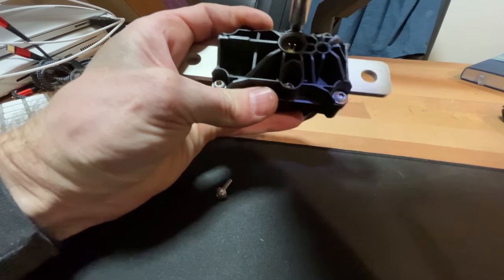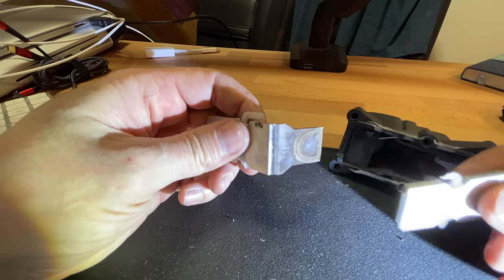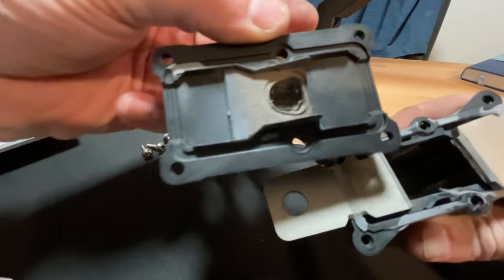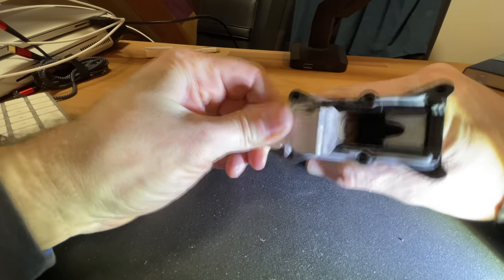After I took out the blown fuse, I had to take it apart to see what was going on. It's pretty neat — the fuse itself is a straight metal bar with two weak points on either side. This used to be straight. At the bottom there is the explodey part — this one has exploded. When it exploded, it broke one of the weak connections on the metal bar, bending it out of the way and disconnecting the two sides.